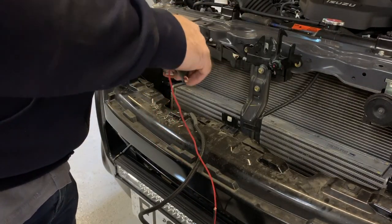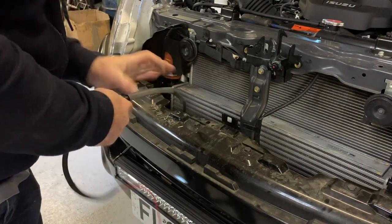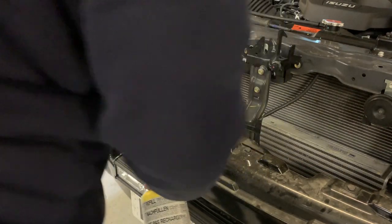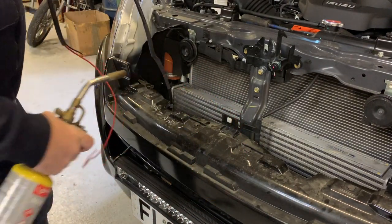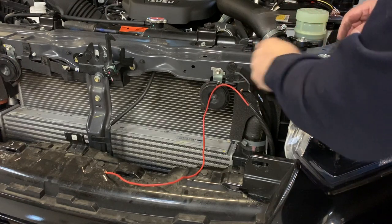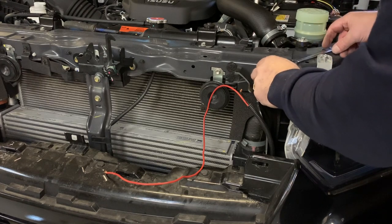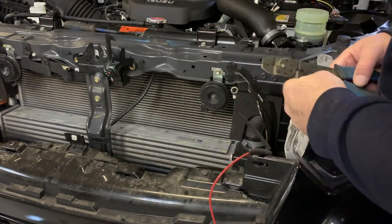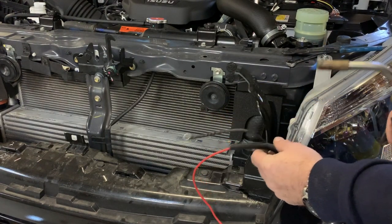Here I've moved on to the wiring and making up a harness as I go along. I do like shrink wrap or heat shrink tubing — get it all weather tight and protected from rubbing. A bit of a brutal way to heat shrink but it's effective. Carrying on with routing the wiring, I found myself an ideal spot for the earth, just checking the bolt had a captive nut on the back. A little loop on the end of my earth wire, more heat shrinking, got that loop on there.